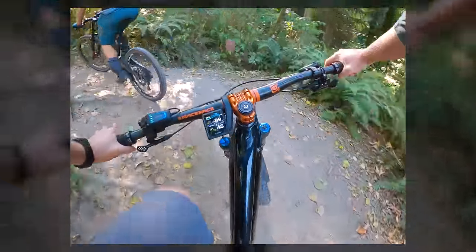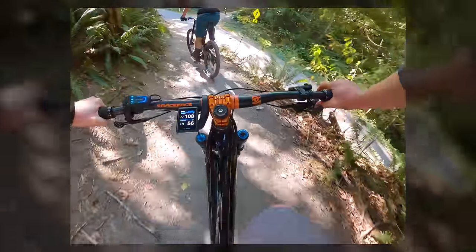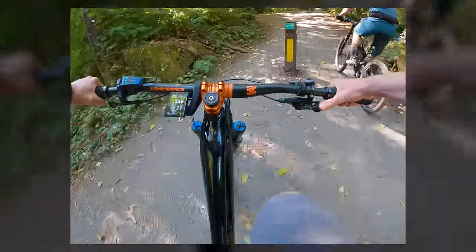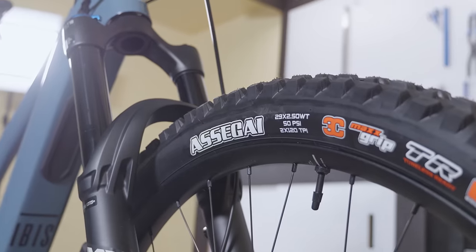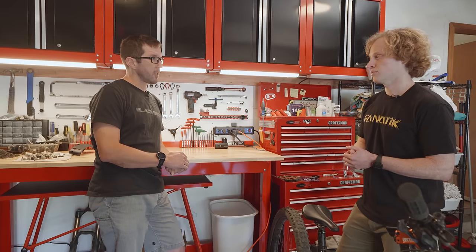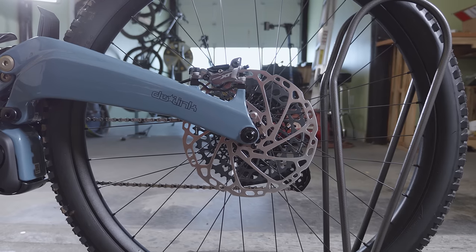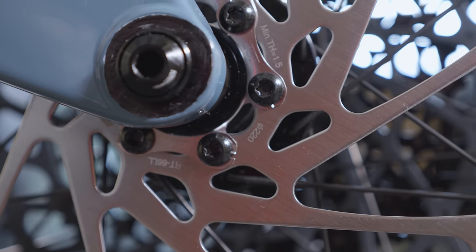To me, trying to make something that's no longer just a bicycle seem like a bicycle seems kind of fake and contrived. Just let it be what it is — and it's still fun. Trying to keep the weight down in ways that end up being irrelevant or take away from the experience — like tires are the worst place to try to save weight on an e-bike. We identified a number of things that e-bikes need: beefy tires, a lot of traction, a little extra suspension, and the biggest and strongest brakes you can possibly get. So we have 220 rotors, four-piston brakes, and Double Down tires. We basically maximize the amount of control you have of the bike because it's a big heavy bike.